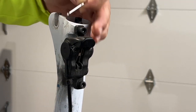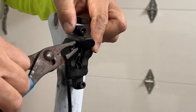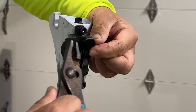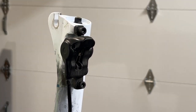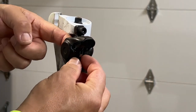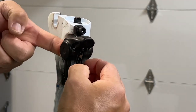You need to take a pair of pliers and straighten out the cotter pin so you can pull it out. Just go ahead and straighten out the cotter pin and then pull it out. And then it's just a matter of pulling the brake pad assembly and pushing it out.